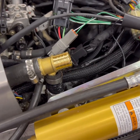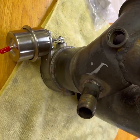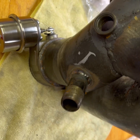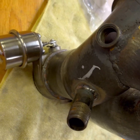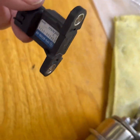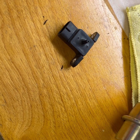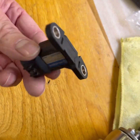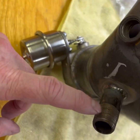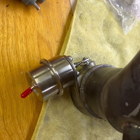One last thing about the evac before I move on to the exhaust: this setup is supposed to draw a vacuum, so what if I could measure that? They say never throw away parts — look at that, that's my OEM MAP sensor, a one-bar unit. It'll measure up to about 1.8 psi of pressure and then the rest is vacuum. I could hook this up with a T into this line and measure the vacuum.